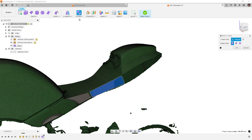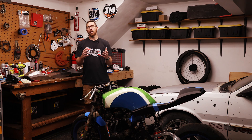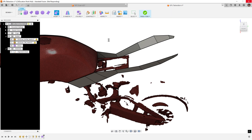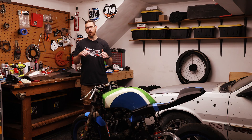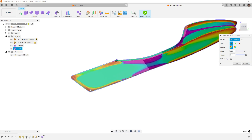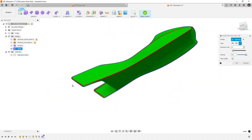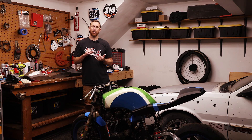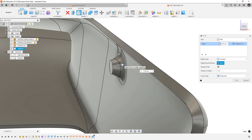The modeling video is going to take probably a couple of hours because there are a lot of techniques to understand. We build it out with a very low face count first — get the box shape looking right — then start adding detail where we need it, controlling the edges, working on edge flow for disappearing or moving edges. You have to spend a lot of time with star points, n-gons — anything with more than four sides or triangles — moving those around so the final shape is nice and smooth. Once we convert it to a solid, we'll add recesses and details for mounting to the tank and spaces to mount to the subframe once I build and weld sheet metal brackets on.